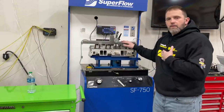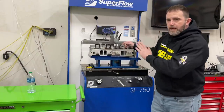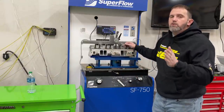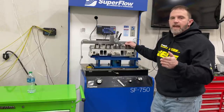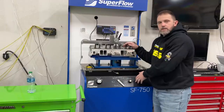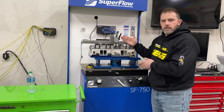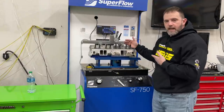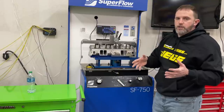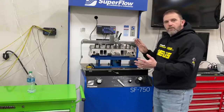I always give you flow bench numbers, and people think that I only care about airflow in general. Not really. Like I said, all of this just gives me information. Everything that this flow bench tells me just tells me information, but it's how you use that information that makes it more valuable. You can't take any one thing as that's all there is. Even though this tells me flow, I know it's static — it's just pulling air randomly. It doesn't have a valve going back and forth in a dynamic situation like an engine does. I have to take that into account. But I do think the flow from this has some information that's valuable for an actual running engine. You also have sizes, velocities, and the port, and a whole bunch of other stuff — everything kind of affects itself.